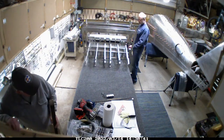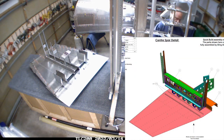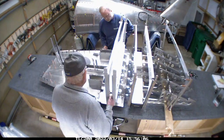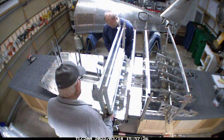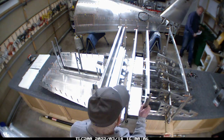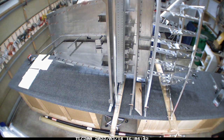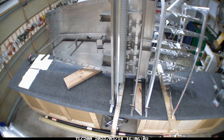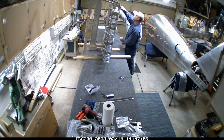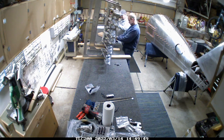We've got all the bottom floor section done and it's time to do a first fit to see how that part's going to attach to the main spar. You can't put the Clecos in to hold it in place when it's sitting on the bench, so I find it's easier to just stand it up on its side. I didn't have any foam that was recommended as part of the material to help support the build for this section, so I ultimately went to the hardware store and bought a sheet.